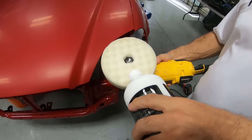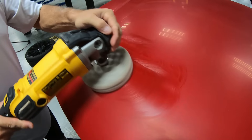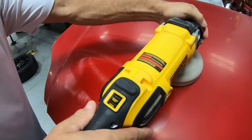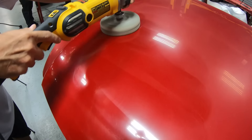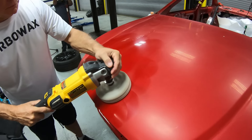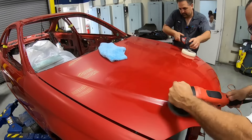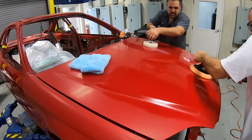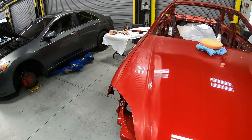When entering into the detail world, there are many ways to polish your car. The way I like to start every polish job is to use the rotary buffer. Although it's very dangerous if you don't know how to use it and you can mess up the paint, it will speed up the process. If you follow up with a random orbital polisher you're going to have a beautiful finish — you do need to use both. Even after a couple passes with the rotary, that's not finished quality — you can see it's got marring, buffer scratches, and buffer trails. So I use the rotary buffer to get all of the 2000 and 3000 grit scratches off the panel, and then follow it up using the random orbital polisher.